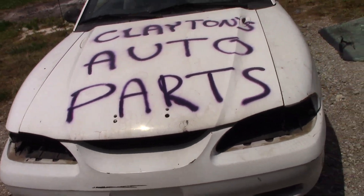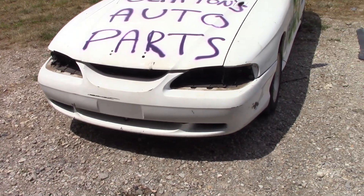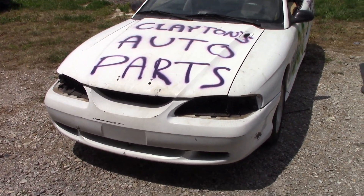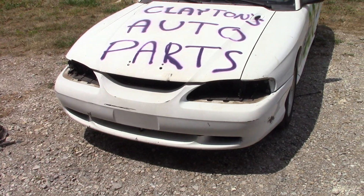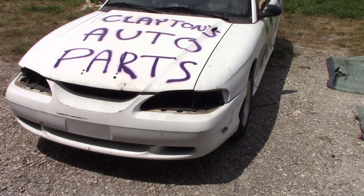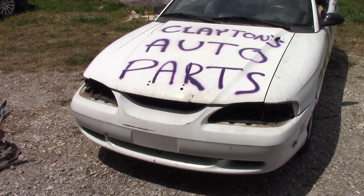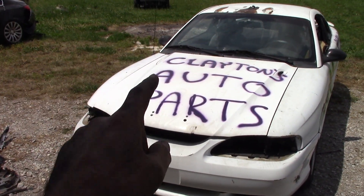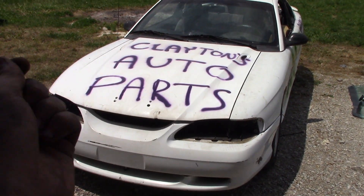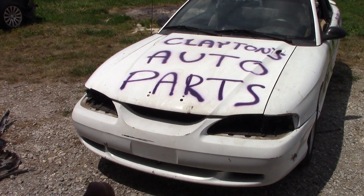The only reason we found this out is because we filled the coolant — the radiator was just a bit low last night. We filled it all the way to the top, came out in the morning, started the car, and the motor was completely locked up. I had a suspicion it might be locked due to coolant and the head gasket issue, since these are so common on this engine. I immediately started pulling spark plugs, worked our way around the engine, and sure enough the passenger-side rearmost spark plug was soaking wet. Left all the plugs out, cranked the engine, and it blew the water out of that back cylinder. All the other ones were good and dry, which is a good sign.